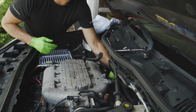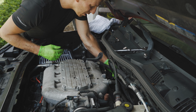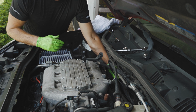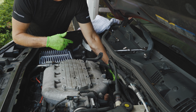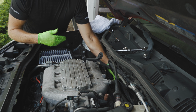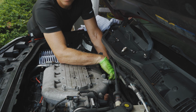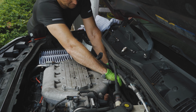spark plug down in there, then drop your socket on top of it, and then drop your little extension, get it connected, and just hand tighten it as we did in the front side. And like I said, it should be free to spin for quite a ways, and then eventually you'll feel it tighten. You shouldn't feel any kind of awkward resistance or anything like that. Okay, you just tighten it nice and snug like that.